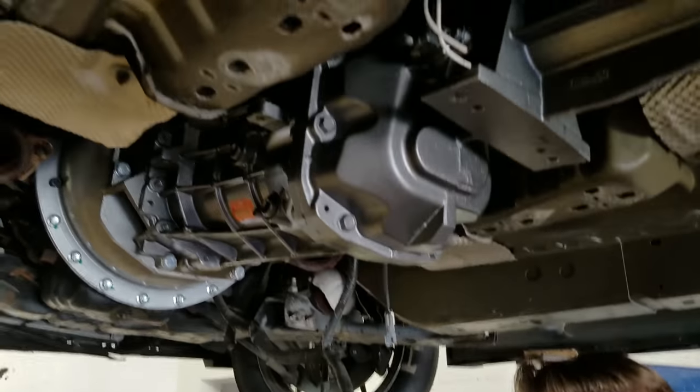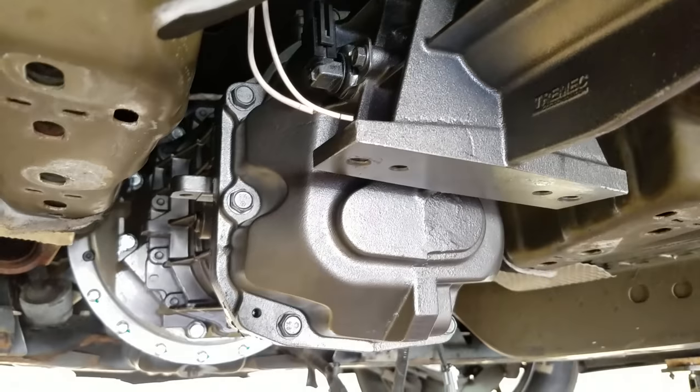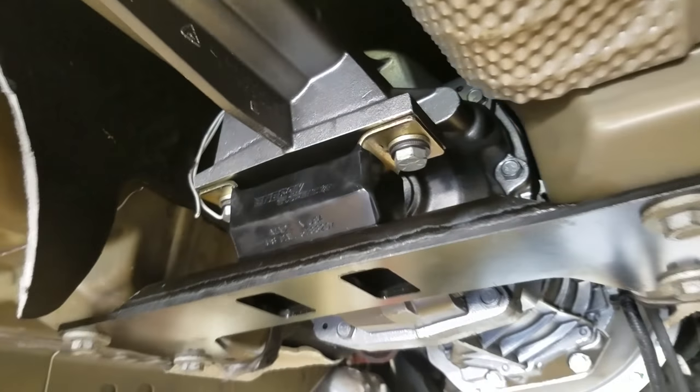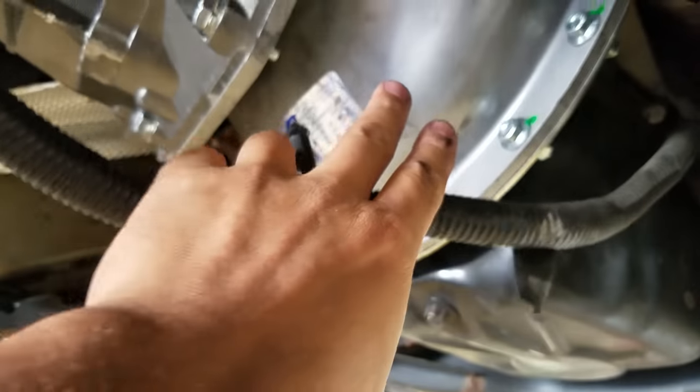It's in — it sucked, it wasn't fun — but we got it all lined up and that's what it looks like installed. The shifter goes in from the top like an old-school T5, so that'll be last. Drive shaft and crossmember hopefully fit, and wiring needs to get figured out. Got the polyurethane mount from Summit and the billet mount from Billet Pro Shops — everything fit really nice. The only fitment issue was lining up a dowel, but the drive shaft fit, which was my biggest fear.